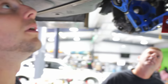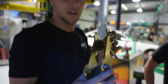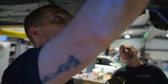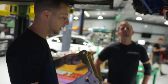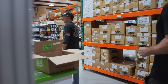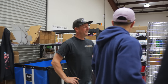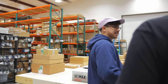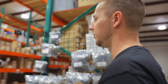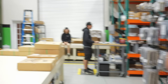They said no Condor bushings - something that is OEM thickness. So I'm going to run over to Drift HQ to see what we have that's actually going to fit. We might knock this one out and put the new one in, but worst case we'll just shave down the face of this. At Drift HQ - we need E92 diff bushings. We have Condor in the car already and the Condors are a little too fat. They recommended AKG or some other brand.